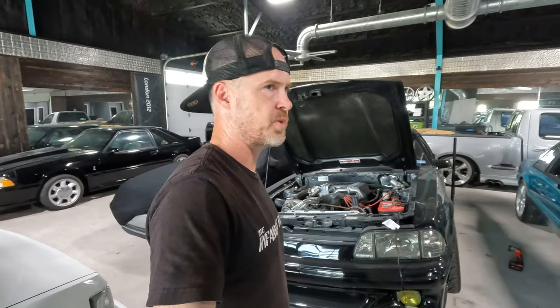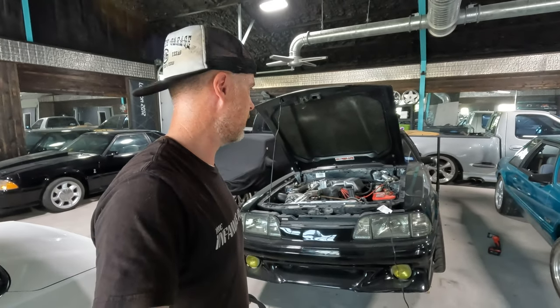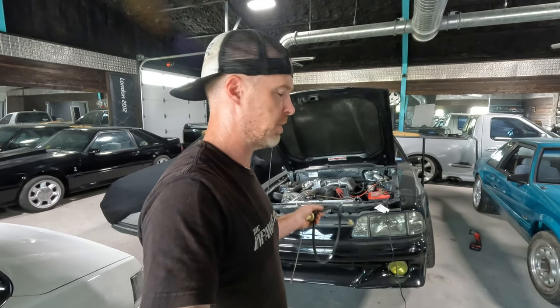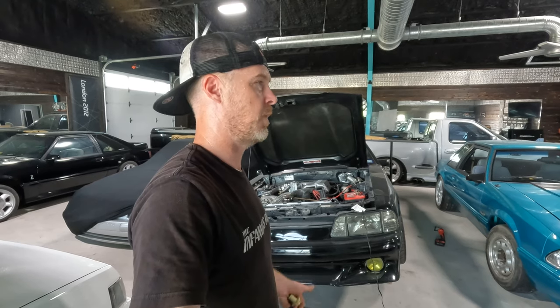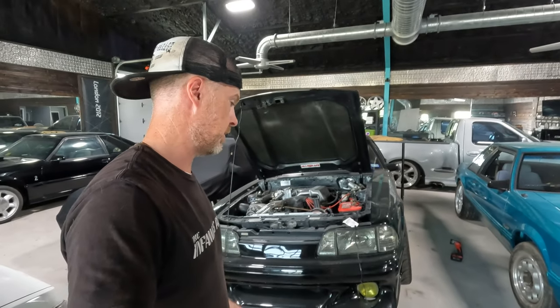And it's just one of those things, like when you need to adjust it, a firewall adjuster helps. You can spin some stuff, you can give it some slack, you can tighten it up depending on what's going on. But the adjusters on the underside where you have to leave the cover off for your clutch fork, that's another pet peeve of mine. Guys, if you got the cover, put it on. Why do you want to send potential debris up in there? I know people probably argue and say it's no big deal. Well, if you got a cover, just put the cover on.